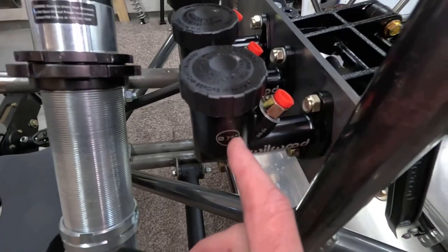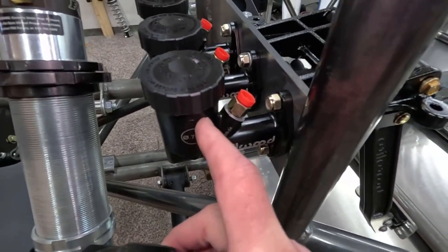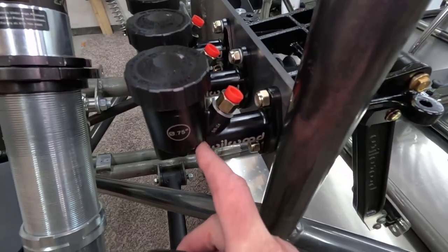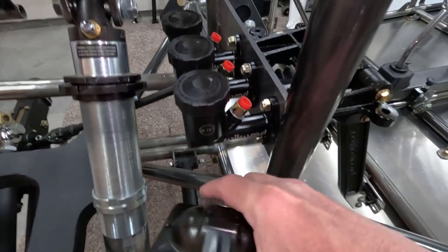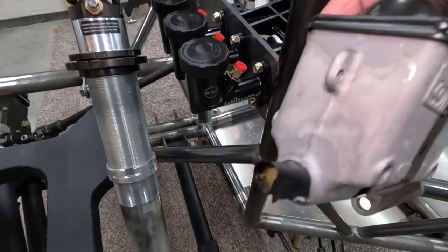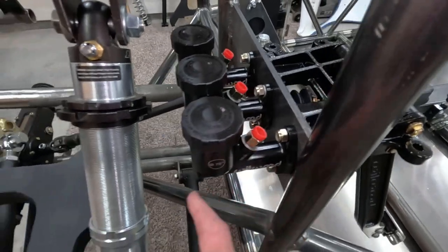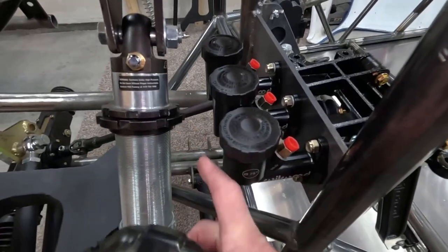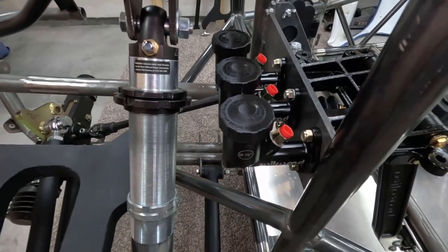So I found these master cylinders also by Wilwood. I'll also put a link in the description for these if you're curious. These are also 3/4 bore. These are about an inch shorter, and another big difference is on this one, the port is in the front. On these, the port is back here. So it really gained me a lot of space up front here, and now I've got plenty of room for the shock absorber and the springs.